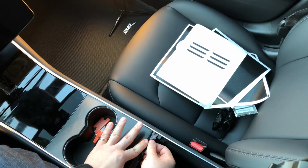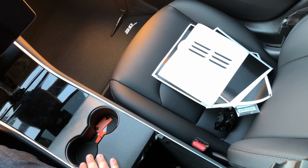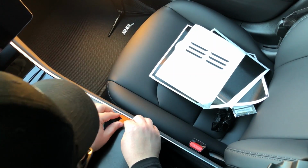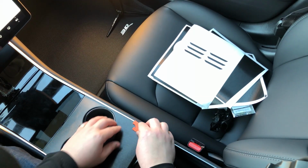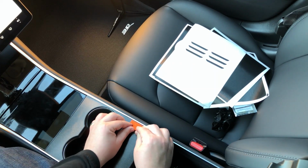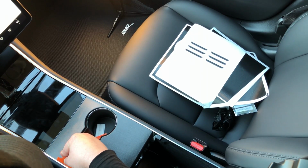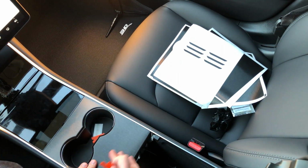And here you go. We're all the way at the edge. Now, once you're at this point, you want to take your bigger bullet blade, because I'm happy with where everything is installed and where it's sitting, and you're just gonna push on the material along this edge, and you're just gonna tuck any that's here under the edge. So nice and easy, go along the edge, push it in. The big one's good for this. The smaller one is also useful for this. But you just push it in, and then you have all that extra material cleaned up.